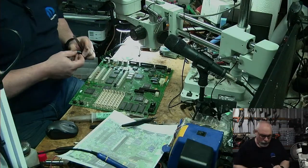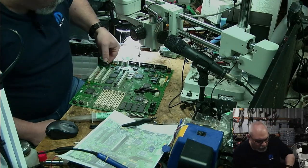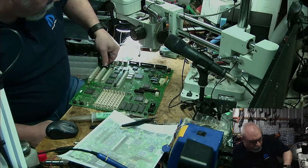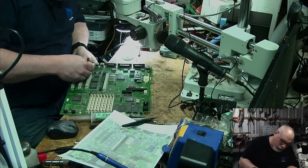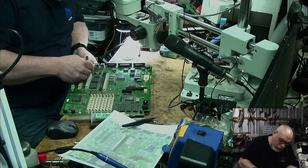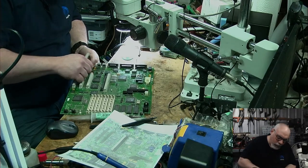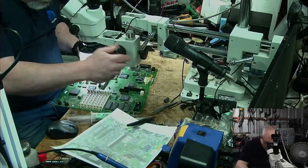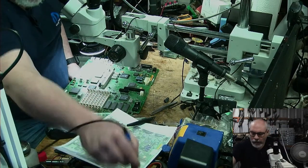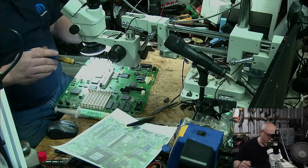This would be so much easier if I had my quick keys working for this. Okay, this time I'm going to put this capacitor on the right way, with the negative pointing to the negative, and the positive pointing to the positive. We will have far more success if we do this. I haven't left myself with enough hole to get this bloody pin through. I'm going to have to try and suck some solder out. Sorry, folks. What a pain. And this is all for my own stupidity.